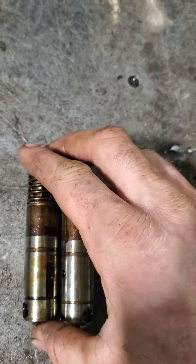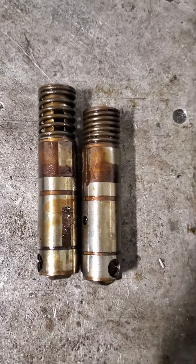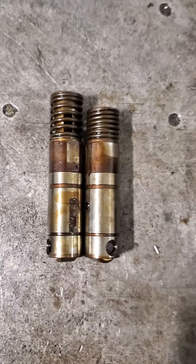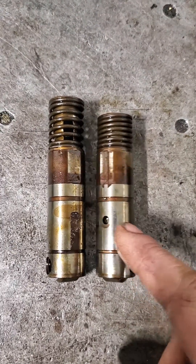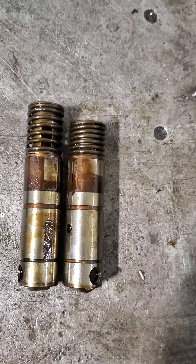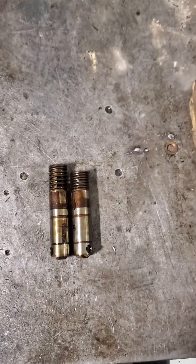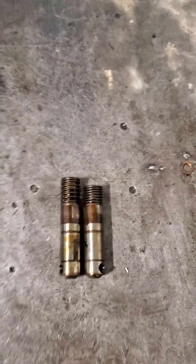What I see happen a lot is people say they took it to a dealer — and I worked for a dealer — and they have their car worked on and they charge them for a camshaft almost every time. But what happens is if you don't drive it when it collapses, most often your camshaft is in pretty good shape and you can just put AFM lifters in that bank with a new manifold and that fixes your problem. There's your little learning for today.